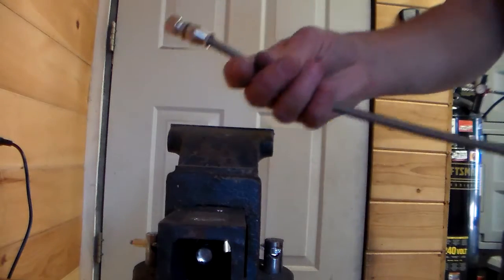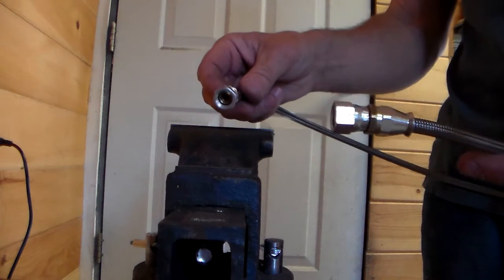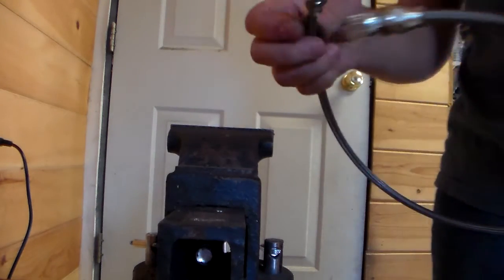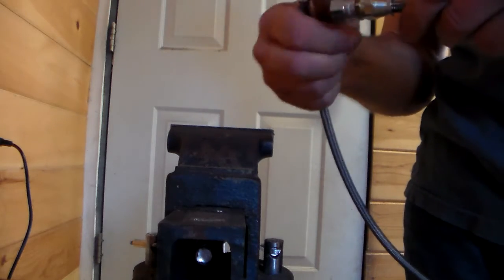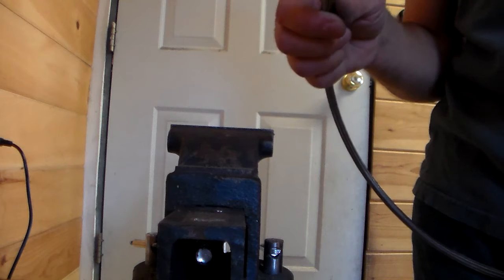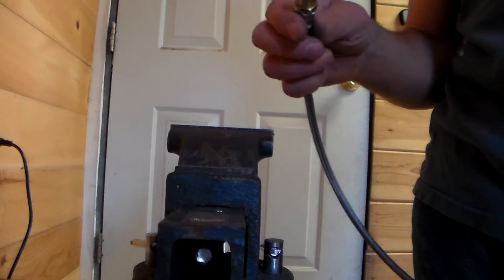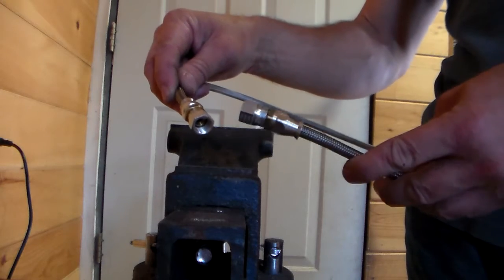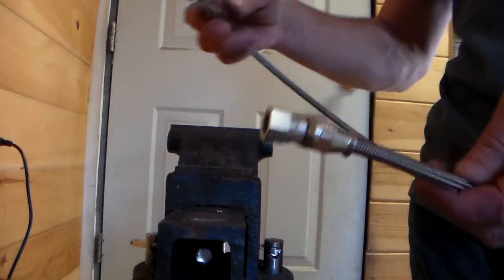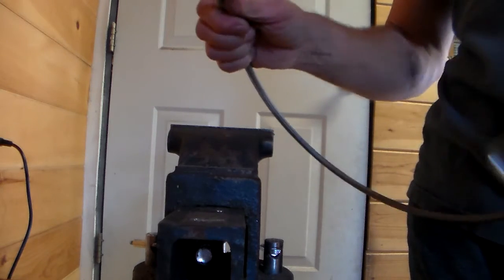So there we have this type of fitting on both ends. You might struggle a little bit with the stainless fraying when getting that cup in — that's the trickiest part. But they give you enough hose that if you make a mistake you'll be able to make the line over again. If you cut them a little bit long you can always trim the slack, and if you can't get that cup in, just cut it, tape it, cut it back a little bit more, and try again.